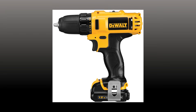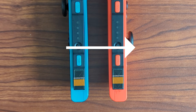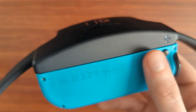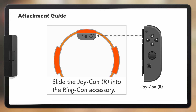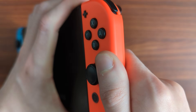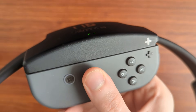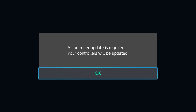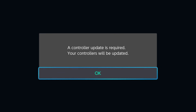The Ring Con essentially uses the Joy-Con for its own purposes, almost acting like a battery pack — it reminds me of how electric drills have interchangeable batteries. Because of the way the pins are lined up, either-sided controller works. On both Joy-Con, the pins are set up in the same order while the rail is facing outward, meaning a left or right Joy-Con can function in Multitask Mode. But only the right one is functional in-game for software reasons. The way the pins are lined up also prevents accidents if a Joy-Con is put on backwards, ensuring power and communication won't be sent to the wrong pin. Interestingly, Joy-Con with older firmware versions are unable to initiate Multitask Mode or communicate with the Ring Con — this could be because the controller wasn't initially programmed to send power out when clicking in the stick, and in-game it might not know how to complete a handshake with the device.